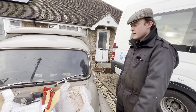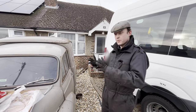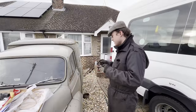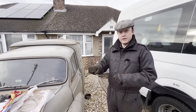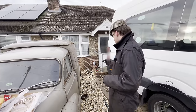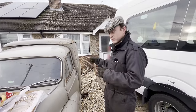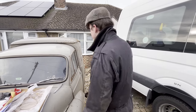So what we're going to do is start the opposite way to taking them off. I'm going to assemble the brakes - wheel cylinders, shoes. I've got brand new shoes over there. Get all of the four corners done and then start running lines. Might actually start at the back because we've got the back lifted up. Wheel cylinders, shoes, springs, all that. Run the lines, get it back now. Let's have a go.